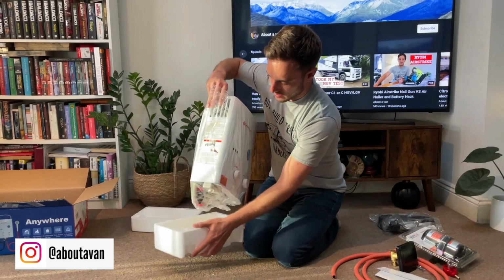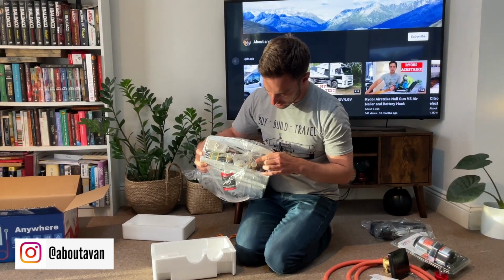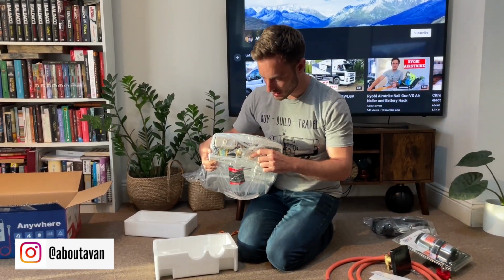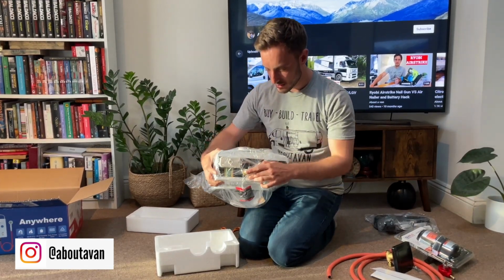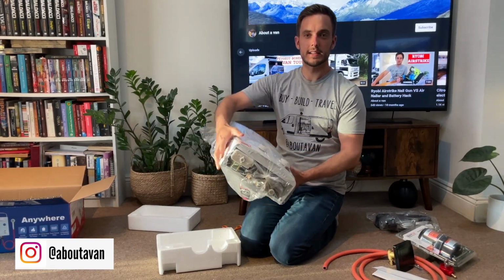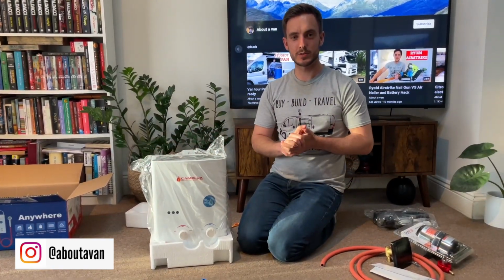And then at the bottom of this unit is where all of your fittings and connections are made. One of these is going to be your water in, which I think is here. It says water inlet. The next one across is water outlet, so that's going to be your shower head. And the other one is going to be gas inlet. So that's going to be the gas hose here, and that's the one that we need to find a connection for. So the next video is going to be me installing this on the van and hopefully having a hot shower. So watch out for that next week.